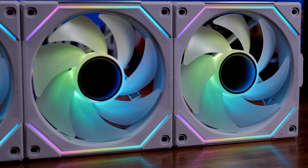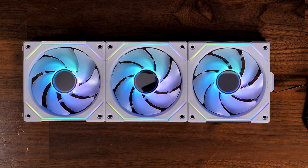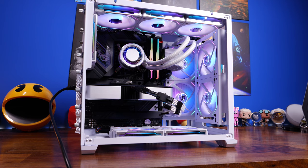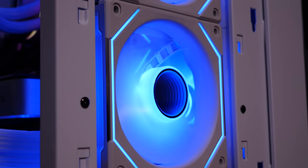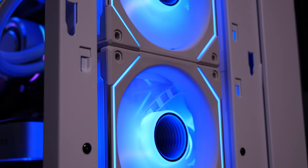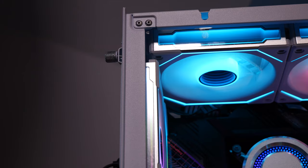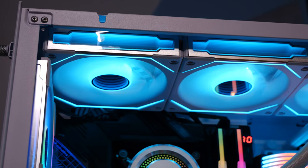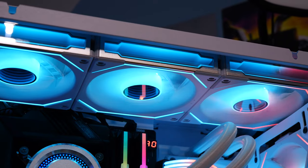The infinity mirrors have a really interesting layering inside them — essentially a 0.5mm gap between each layer which creates really nice visuals inside the case. In this video I'm unboxing and installing them in the Lian Li Air Mini, swapping out the original AL 120s. These fans have improved specs: they run from 0 RPM up to 2100 RPM, have an airflow of 61.3 CFM, a static pressure of 2.66, and a max noise level of 29 decibels.